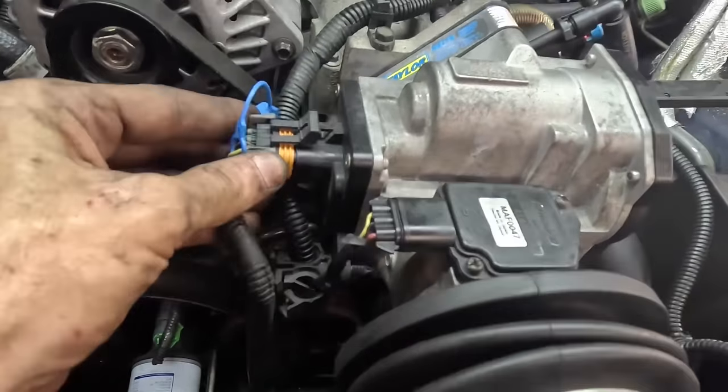See how we're doing here. A lot of bubbles and stuff. That's all the air purging out of it. So while we're here and before this heats up, I'm gonna go ahead and rinse off the fingerprints and whatnot. We'll rinse some of the oil off this engine. The belt's going to squeal, but since it's wet, it's gonna be fine. We'll rinse off the exhaust manifolds before they heat up. We'll rinse off everything: the undercarriage, the subframe, radiator, the battery, the intake.